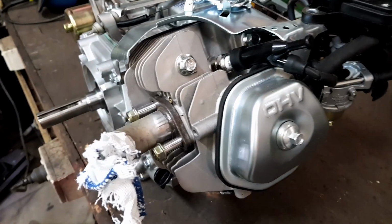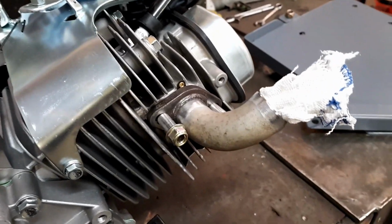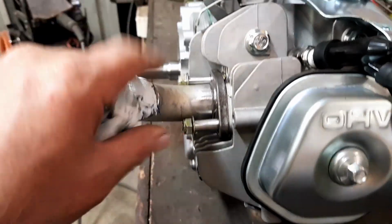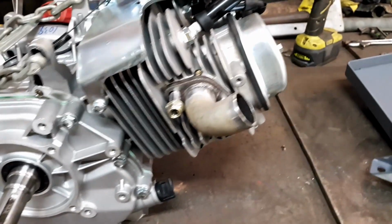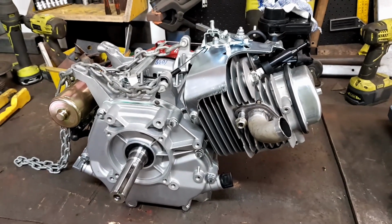And with the exhaust, because it had this big cumbersome looking thing over there, I've managed to find a couple of old pipes and bits and put little extensions on it, because it had really thick cast steel in the previous one. So at the moment it's just a little straight pipe to get it away from everywhere, and then I can add on to it and either go down or to a muffler or something. I'll probably have to put a flex joint in there or a slip joint at least, so it's not so noisy.